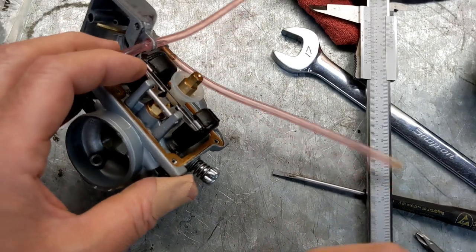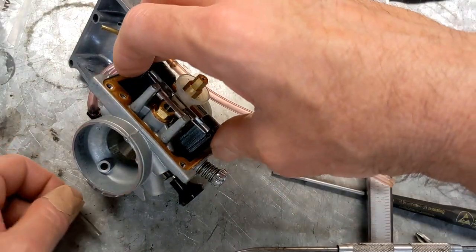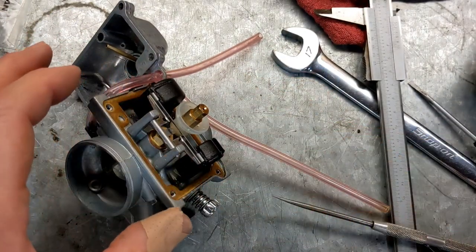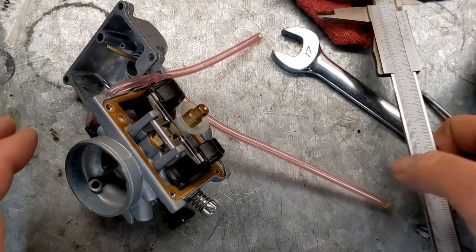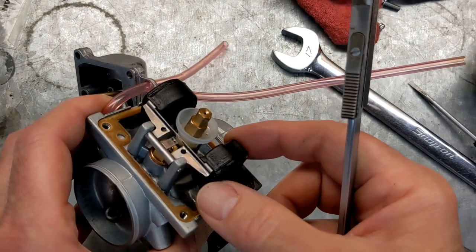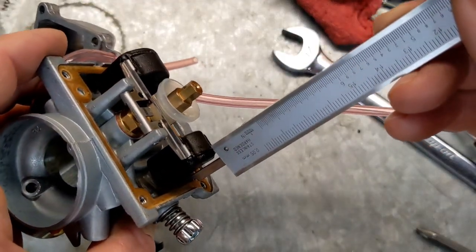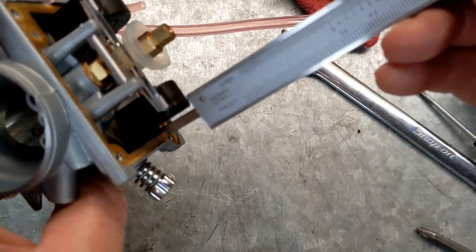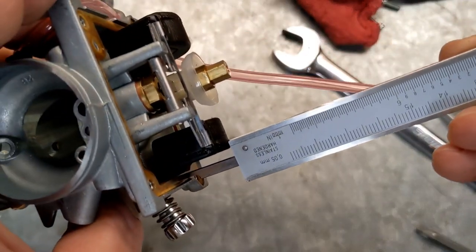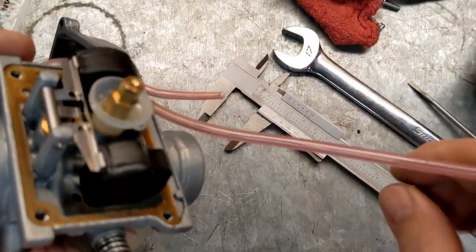So this is the point where I get aggressive with it and either break something or overdo it. And this might have corrected that leak problem. I may not have needed to get the fuel pressure regulator, maybe. But it's also possible that this motor is capable of running pretty high RPM. Look at that. Lined up. So it's parallel to the bowl, and it is right on the money right there. So we're going to call that done.